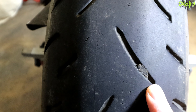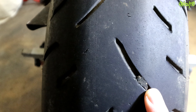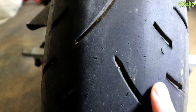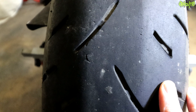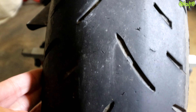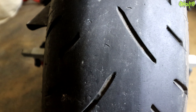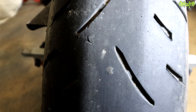Can you use rope plugs permanently? No, you shouldn't — manufacturers don't recommend it unless you can find one that says you can use them for the life of the tire. However, in this one case example, they seem fine as long as they're fitted correctly. When I first fitted these, a lot of people said it's gonna fly out after two minutes — I think those people just hadn't fitted them correctly. If you fit rope plugs properly the way the manufacturer says, they should last a long time, if not the length of the tire. I've just checked the wheel over and I can't see any new nails or screws, so touch wood I've been quite lucky recently.